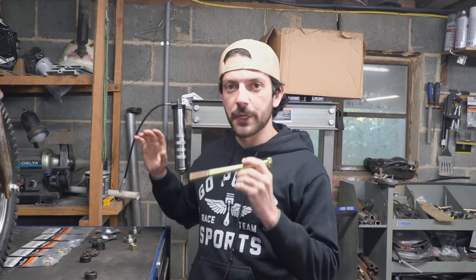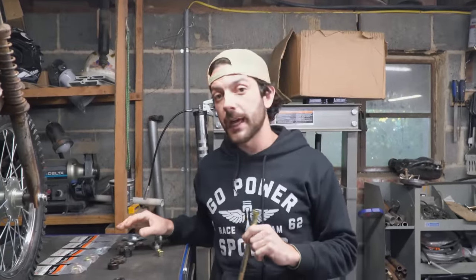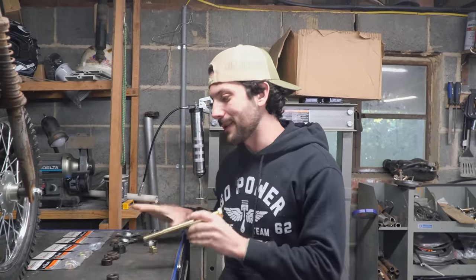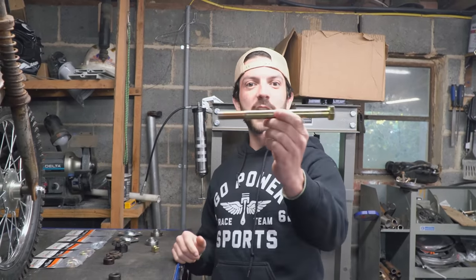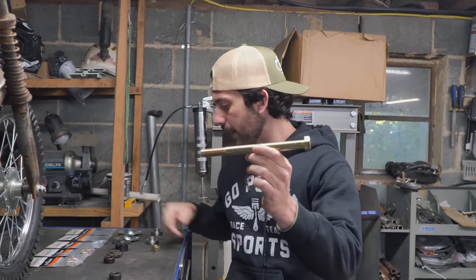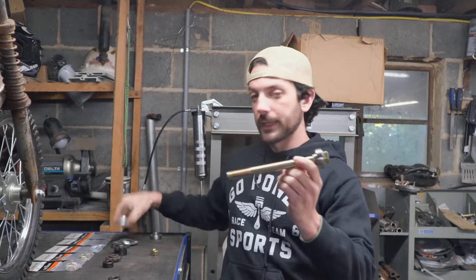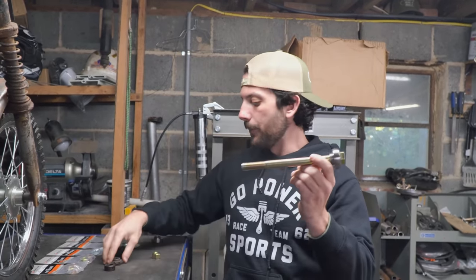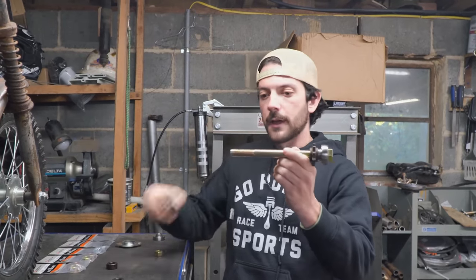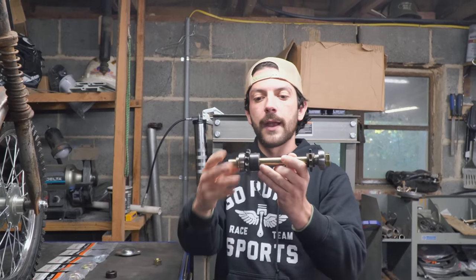So a couple hours later and we should have everything we need for a jackshaft minus our brackets. We went to Tractor Supply, but we could get this done cleaner and cheaper from going to gopowersports.com. This is like over $100 worth of stuff. Here's our jackshaft. We're keeping it Cars and Cameras. It's 5/8 bolt. We're gonna need to cut a keyway into it. We're gonna have our bearing, 5/8, and we were able to get some hangers as well. We're gonna have our sprocket, some spacers, another sprocket from the engine, which is gonna do our reducing, and then another bearing and some lockdown.